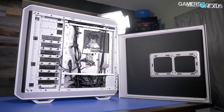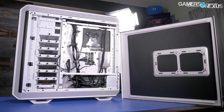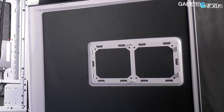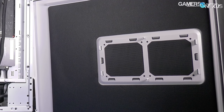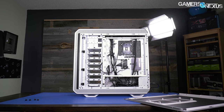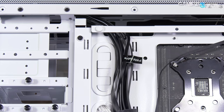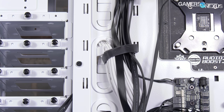The panel thickness is one of the main ways Be Quiet helps deal with higher-pitched whines, and the damping foam also assists by breaking up sound waves. This attention to detail extends to a thin foam ring around the edges of the tempered glass panel to cushion and seal in noise. Two fans can be installed in the filtered vent on the side panel, although this is intended more for the non-tempered glass version where fans can be aimed at the CPU and GPU. Cable management is good but requires planning — cables must be routed through the motherboard tray, as otherwise they'll keep the side panel from sliding on. There are plenty of cable tie points and six Velcro ties, and the sheer size of the case makes it easy to find space. Without a power supply shroud, there's nothing to hide lazy cable management.